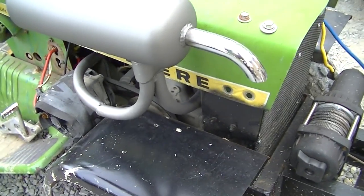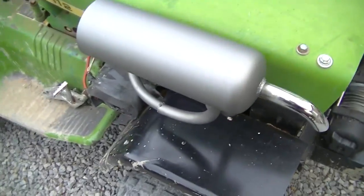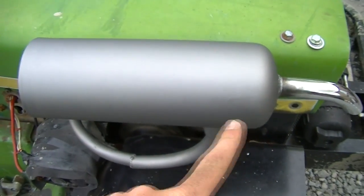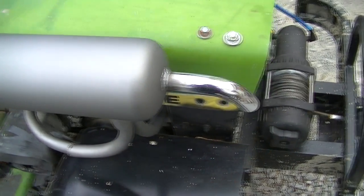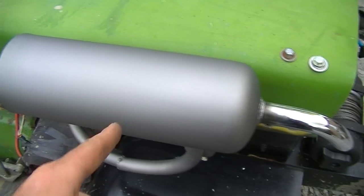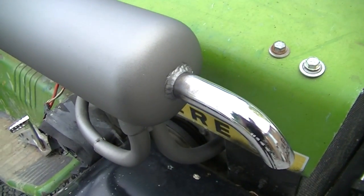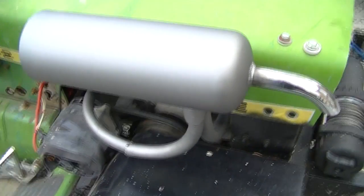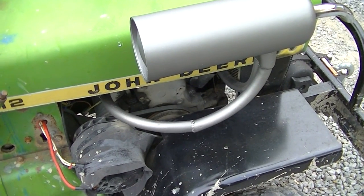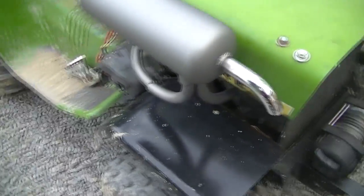The pipe itself is one of those bathroom grab handle things you see in commercial washrooms, so that old folks and invalids don't fall on their faces trying to get on and off the potty. All I did was cut it to the length of the can inside, plus leave some to go outside with the turndown. Much like the last mufflers I showed you from Mule, I used my grinder and put a bunch of slices down the pipe, flipped the pipe over, put a bunch of slices up the pipe, threw the pipe in the can, and welded it in. Obviously I cut the neck off the fire extinguisher and opened up the hole just slightly to fit the pipe. The actual fabrication took me less than 30 minutes. It was a really sweet, easy build.